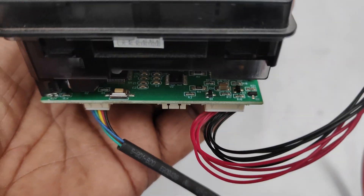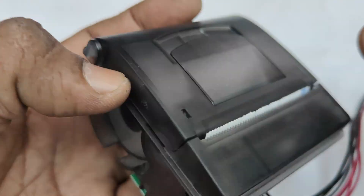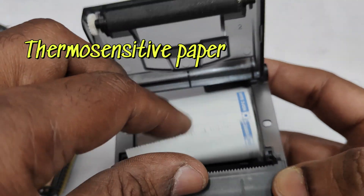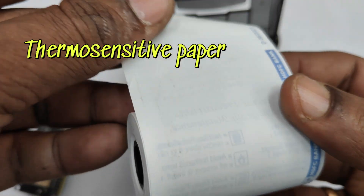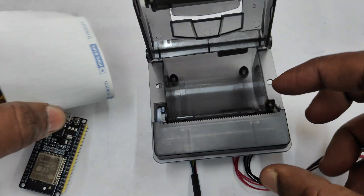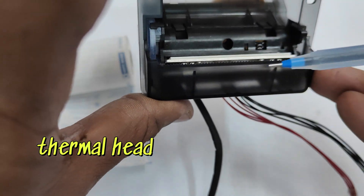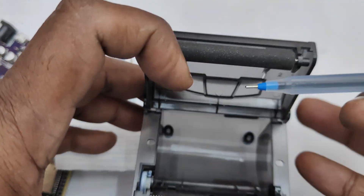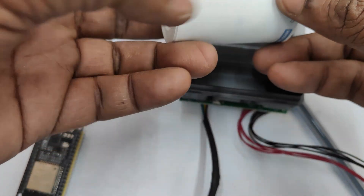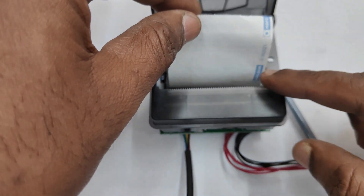At the top of the PCB there is a reset-like button used for printing the test page. You can open the top lid and place the thermal paper. This is thermosensitive paper — one side is coated with thermosensitive material, and that side should face the thermal head. The thermal head is at the bottom; it heats up according to data sent and prints on the paper using heat. There is also a roller and a small motor inside to roll the paper.